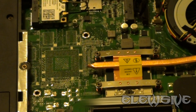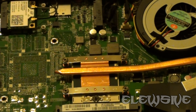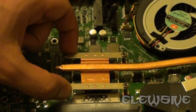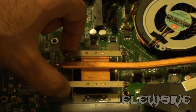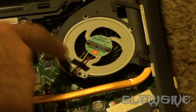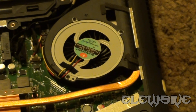So that is the actual processor — it is an i3 — and what I'll be doing is removing it. To remove it, I will be removing the sticker that's on it. Once that's out, there are four screws here. This actually takes off the heat pipe tube. In order to get this processor out, there's actually a little slot, and you might have to bend it up just oh so slightly. The next obstacle is to remove this fan. To do that, there's a pin right on the board — you'll be removing that carefully, which supplies power to the fan. In addition, there is one screw on the board along with another one that keeps this in place. Once those two are removed, you should then be able to proceed and have access to the processor.